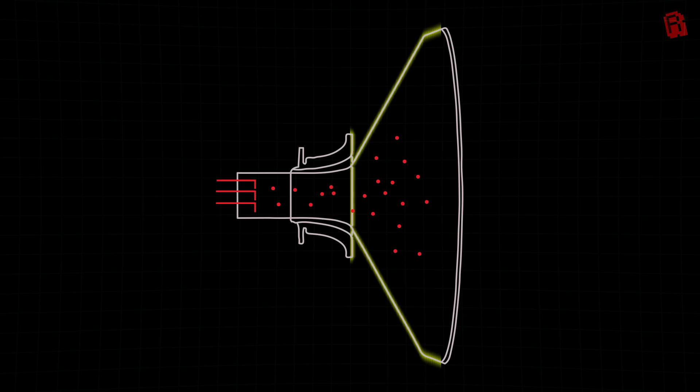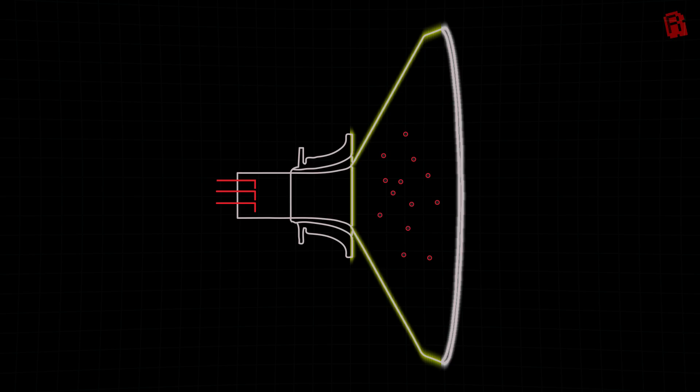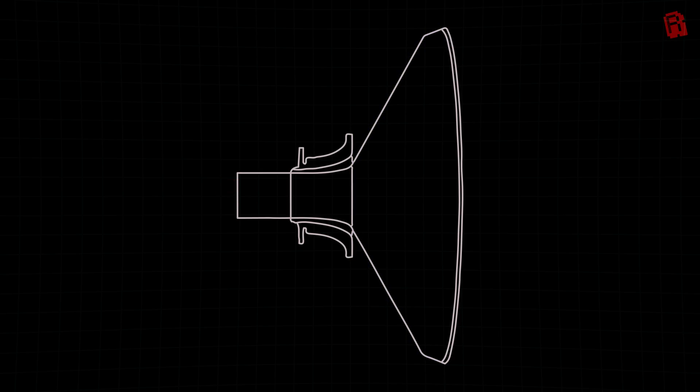If we lose high voltage, we'll get a completely blank screen. That means when troubleshooting, if there's any kind of picture at all — even just a white picture — you know that the high voltage is there and therefore the flyback transformer is working. It's the high voltage on the walls of the CRT that we're discharging when we poke our screwdriver around under the anode cap.